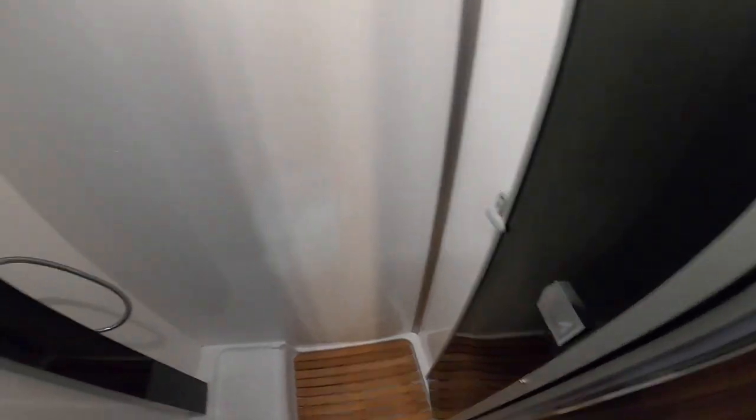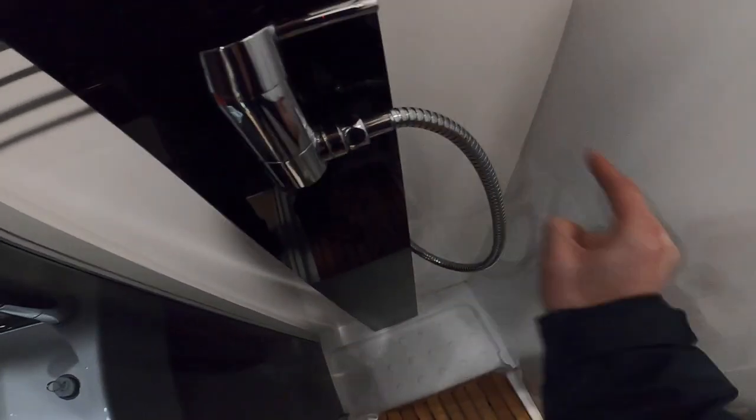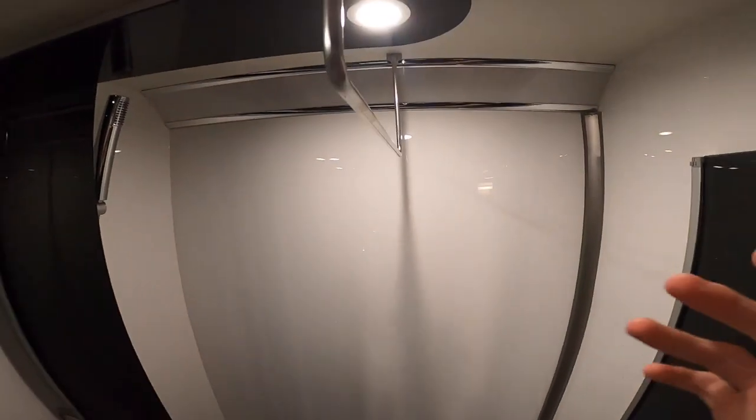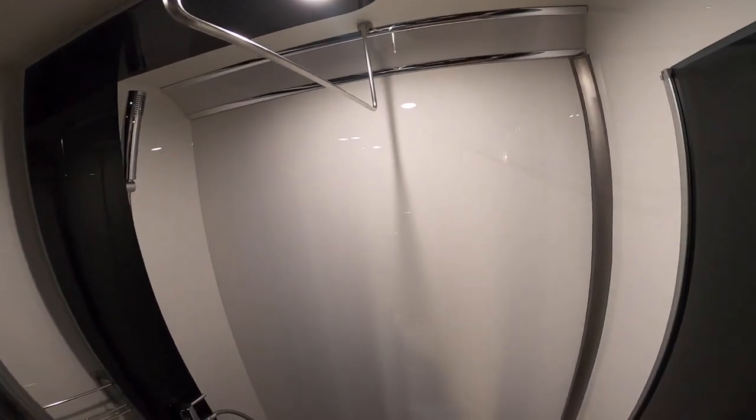Under the sink is your toilet cabinet. The shower screen is secured with a tie-back when travelling. When winterizing the vehicle and draining the fresh water, waste, and boiler, also take the shower head off and allow the shower hose to lie in the shower tray so any residual water drains there. Leave all taps open throughout the vehicle when you winterize. You've also got a towel rail from the ceiling — great after being caught in the rain with a dog. Hang your coats in here, shut the door and put the heating on; it gets lovely and warm as it's the smallest part of the vehicle.